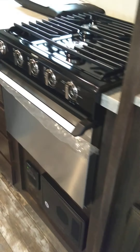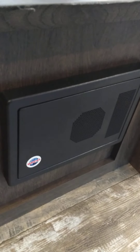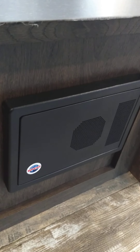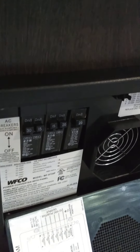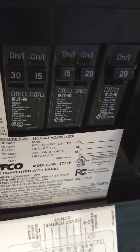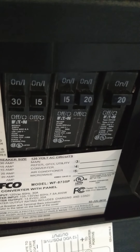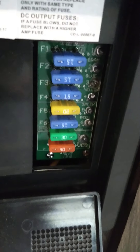This is a power converter — this device converts 110 AC down to 12-volt DC. Everything that can run on 12-volt DC in a trailer does. Some things have to be AC power like the microwave or the air conditioner. So you have regular household circuit breakers here and they're labeled. The power is converted to 12-volt DC over here — you've got regular automotive fuses there and these are also labeled so you can see what they go to.